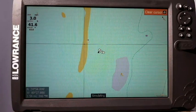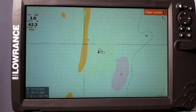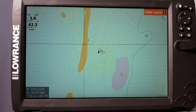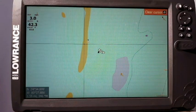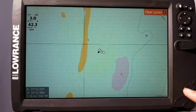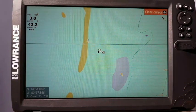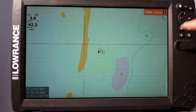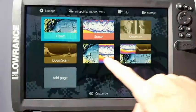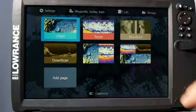The best way to determine if it's some sort of corrosion buildup at the fuse, or maybe a bad connection and your voltage is dropping out once there's an actual draw, is to go in and set up a voltage overlay. You have to set an overlay on a particular page — you can't set an overlay on your home screen; it's got to be on one of the specific screens.